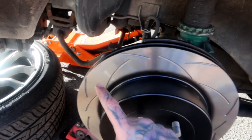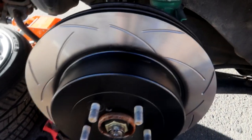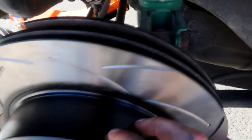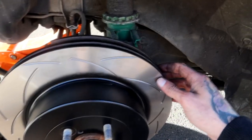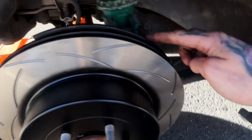So I guess it's a good thing I test fitted. You guys probably saw me put the caliper on without the rotor, just to make sure that the bolt holes lined up — and they lined up really well and the caliper sat where it should. But when I got the rotor on, I put a lug nut on and zipped it down just to put it in place. Up here we have a gap between the dust shield and the rotor, but over here they are contacting. That would cause a really bad noise and probably damage the rotor from rubbing. So what I'm going to do is take an angle grinder and cut off the whole outer edge of the dust shield, and hopefully that will solve my problem.